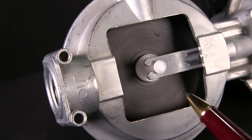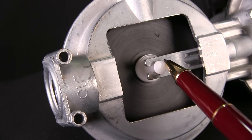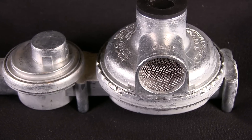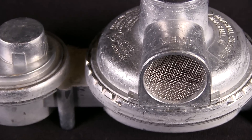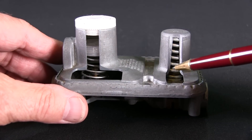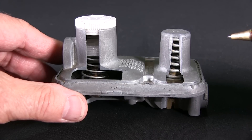Here's how it happens: inside each stage of the regulator there's a rubber diaphragm, a spring, an orifice and a seat, plus levers and pivot points and other mechanical components, as well as a vent opening to the surrounding atmosphere. As fuel enters below the diaphragm assembly of the first stage, its spring is compressed lightly, allowing gas to pass through a fixed orifice which reduces the tank pressure to approximately 10 PSI.